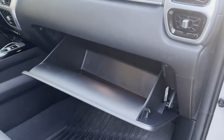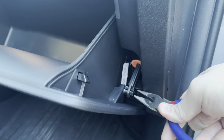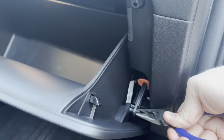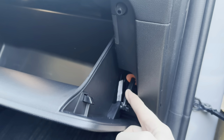The cabin air filter is located on the passenger side behind the glove box. We're just going to take some small needle nose pliers and pinch the two ends of this little post together, and when they're pushed together you should be able to slide this little arm off.